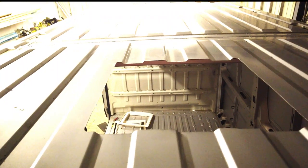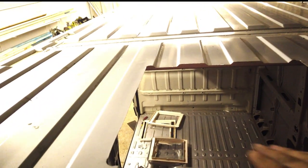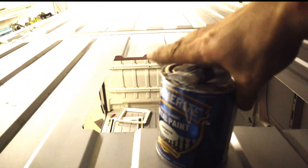That's the hole cut for the roof light. I'm now going to give it a rub along the edges with some isopropyl. This just gets rid of any impurities before the sealant is applied. I'll rub all the edges down and then with a file I'll take off the rough edge before applying some hammerite to the edge.